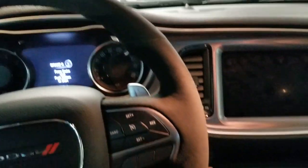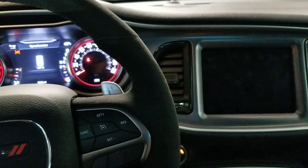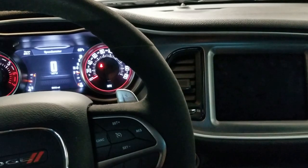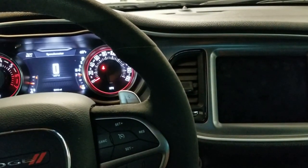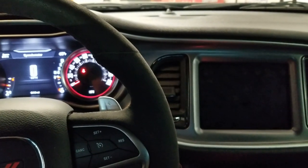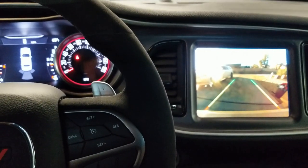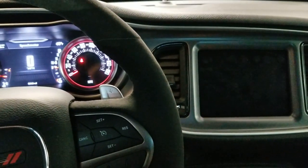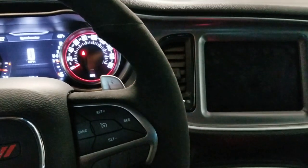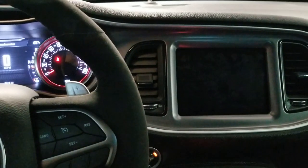So, I let it sit here just for a minute. Let me hit the brake here and see if it kicks on. It does not. Make sure it's on. I got no radio now either. What's going on with that? No radio either. But I noticed when I was using it before, if I put it in reverse, it kicks on. The screen still functions, which means to me that it must be an input issue, because it changes inputs from the stereo to the backup camera when you put it in reverse — it switches inputs. So it has to be something with the input, not the physical screen itself as far as LCD.